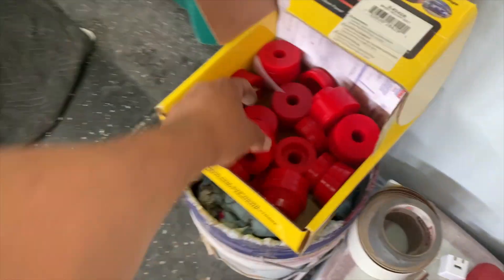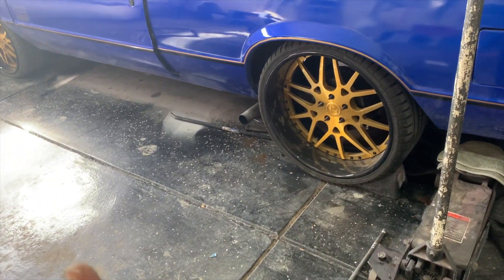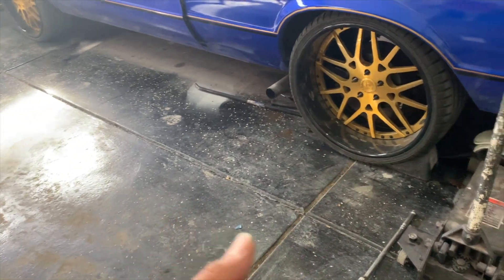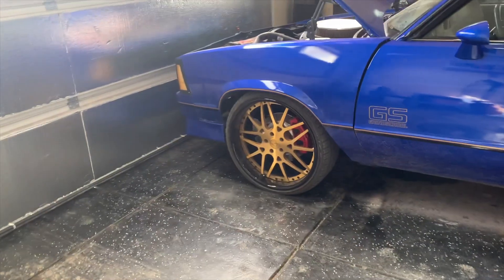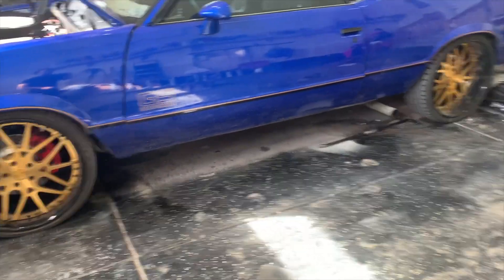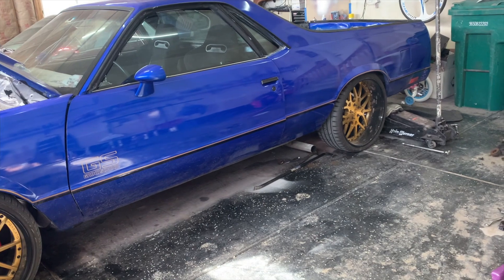The polyurethane is a lot better — obviously it's firm. When I hit corners and turns, this will aid in helping with the body roll along with the QA1s and all that kind of stuff, so the car is not leaning real hard. Piece by piece we're just getting it together. Once I take out the whole powertrain and do everything, I'll go ahead and undercoat it, so all that rusty stuff underneath is going to go away — and it's actually not too bad, not as bad as I thought.